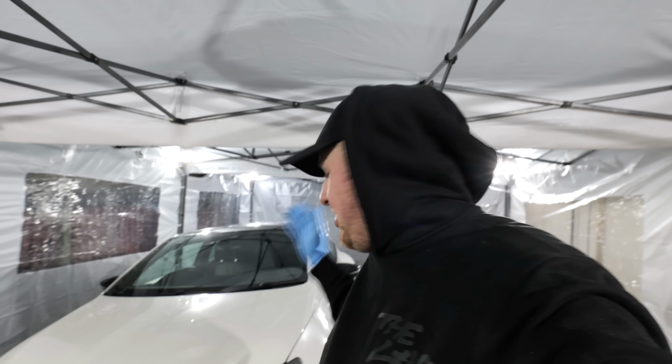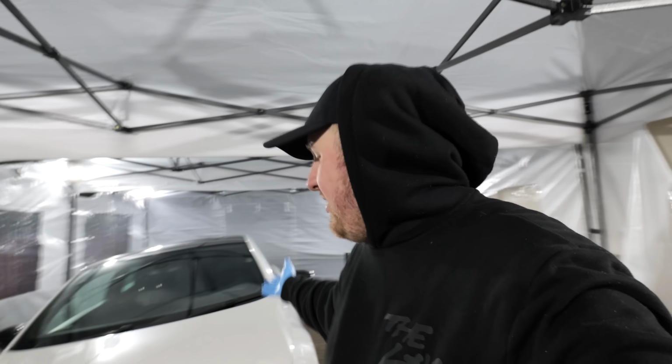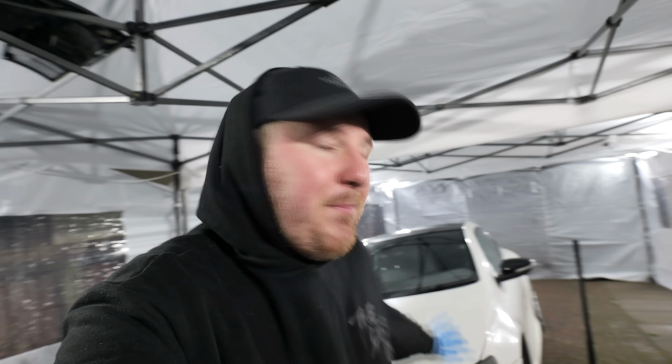So with trying to keep costs down, and I think this would be a better future proof for them anyway, I might try and fix that, and instead of buying a new one and potentially that one snapping, I think what I should do is try and see if I can actually nut and bolt it back together, because all it needs is that rod attaching to the sensor, so when the rod moves up and down, it obviously sends a signal to the headlights and almost tells it in sync where the suspension is kind of at. Obviously this car has been lowered and it's on coilovers, so it does affect it a little bit, but we don't want that to be an advisory on the MOT. We are aiming for a clean sheet. So I think I'm going to give it a go at trying to actually repair it.